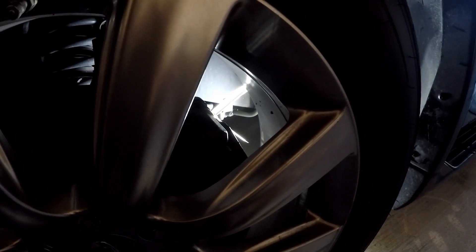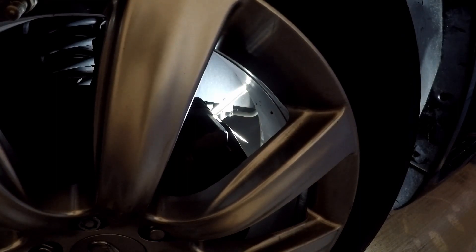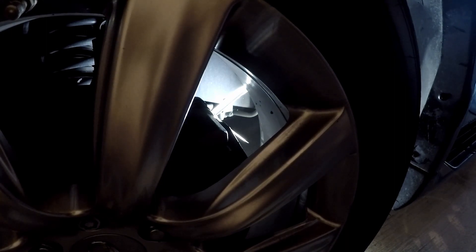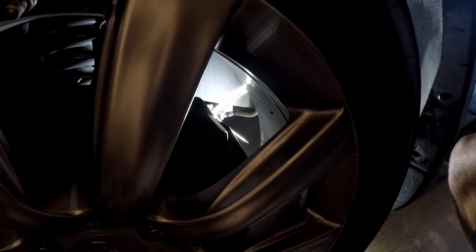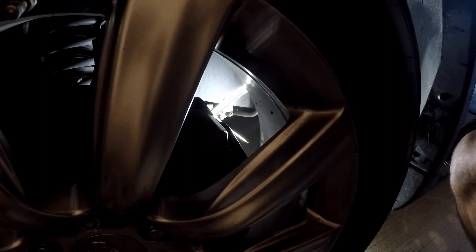I go in the car and press the brake now — listen to what you hear. I went through it three times just to make sure, and my line is completely filled up with no bubbles. I am completely bled — just like that, with three pumps. One of the rear ones I had to hold the brake down until all the air finally came out; it took a second for all the air to come out.